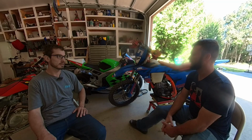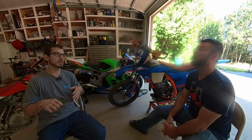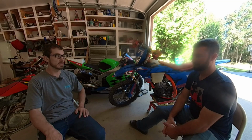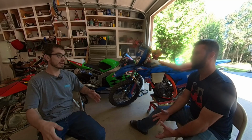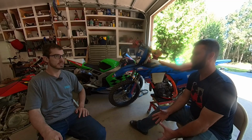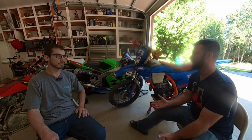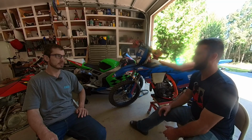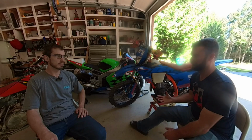And once you get the hang of revving it out too. Yes. Because it's so powerful. It's such a powerful bike that losing that fear of revving it out. Yes. Because this bike will stall at anything under like 3,000 RPM. Yeah. And it has so much power down low. You get used to lugging it and you forget that it's still a four stroke with a huge stroke. Yeah. It revs out to 8,000 to 10,000 RPM. Yeah. But it's so much usable power down low, you kind of just want to tractor everywhere.